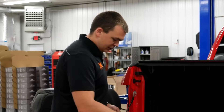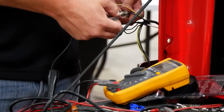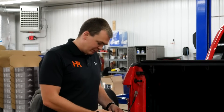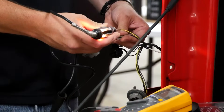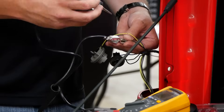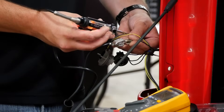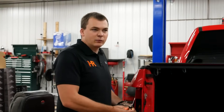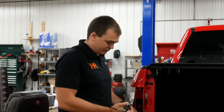One of the easiest ways to test your turn signal, honestly, is with a test light. You probably have one of these at home. Clip this to your ground wire. The cool part about these is they act just like the bulbs you're trying to find. If I go to my parking light wire, it dimly illuminates just like the parking lights should — it's not blinking, not a turn signal by any means. Let's go to the other wire — you can see that's blinking just like my turn signal should be. That's my turn signal wire. Simple as that. If you're looking to just buy a quick tool to test this, not a bad way to go. Test light works just fine.